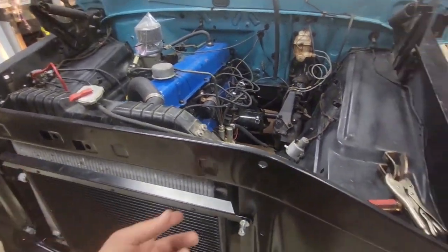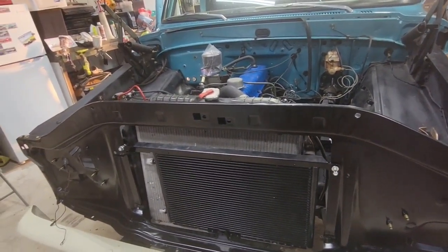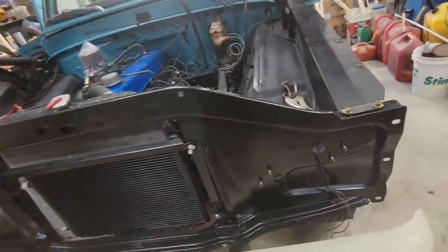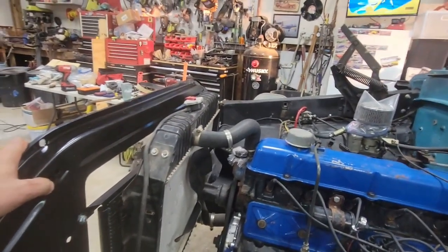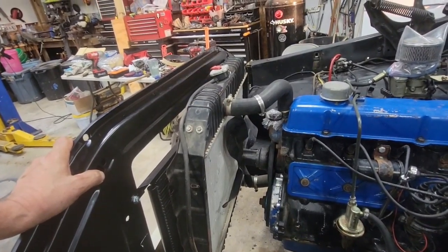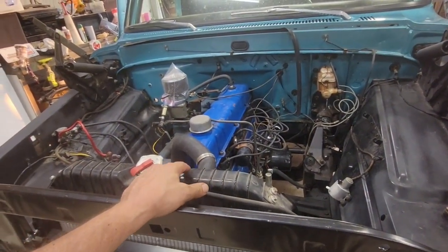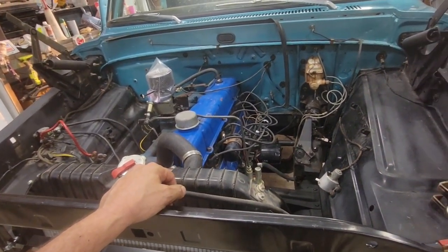It's just a big one — fits the V8-style truck — so it has a bigger radiator opening. I need to go look up radiator numbers and get one that fits a V8 truck. I'll probably just go get an aftermarket aluminum one — I think it was Champion or something. I've bought them before, a lot better radiator, a lot better cost than original — only a couple hundred bucks and they work really good. I've installed several on several hot rods.